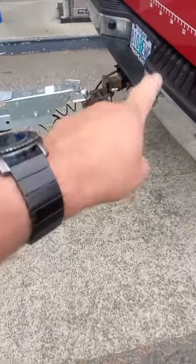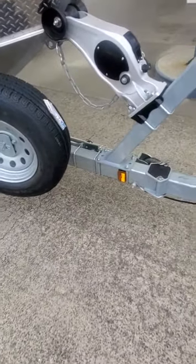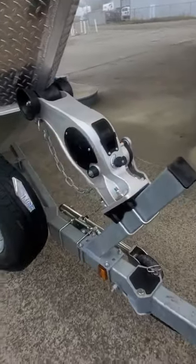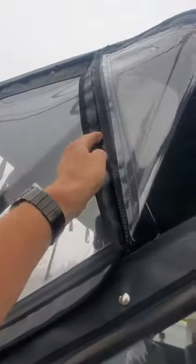Cables are good — you don't have to worry about rust that way. That other little cable that goes like that is your safety cable for brakes. If that came disconnected, it would engage the brakes full. Two-speed jack — these don't rust on you. Pull out that handle right there and it goes into ultra-low. These little curtains here will fold back, and there's a thing on the inside so if you want side curtains to open up, there you go.